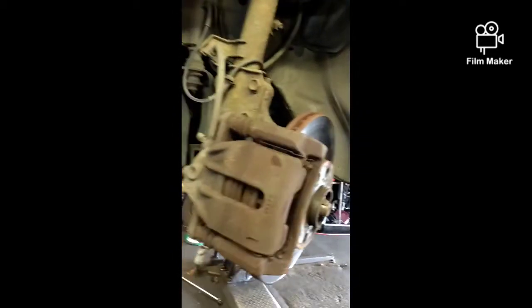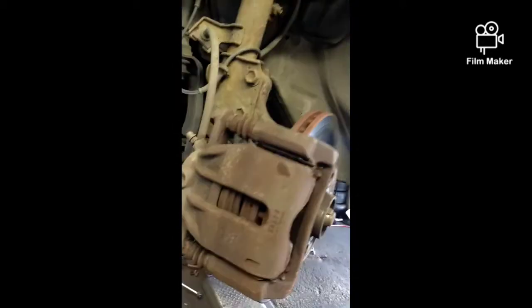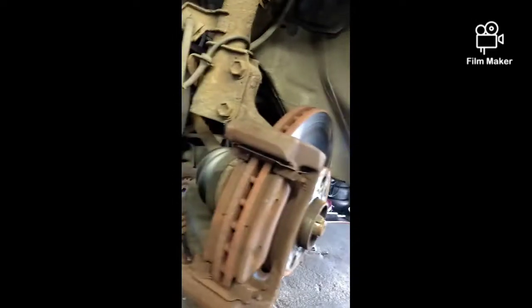The bolt is out, that is ready to come off. All you need to do is swing it over. Safety tip here: don't leave it like that. If you leave it like that and you're messing about taking pads off and it swings like that, you'll trap your fingers — trust me it will hurt. Best thing to do, what I normally do, is take the whole thing off and leave it dangling there. Then you can't trap your fingers or anything.